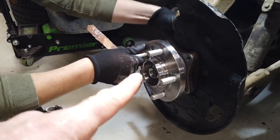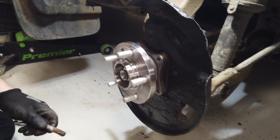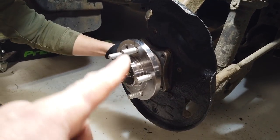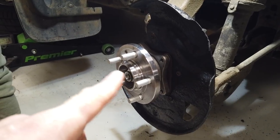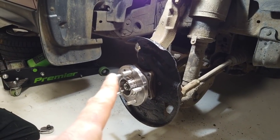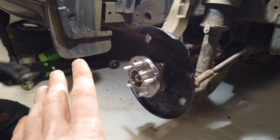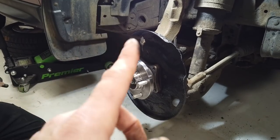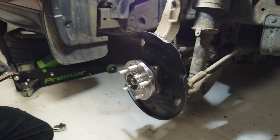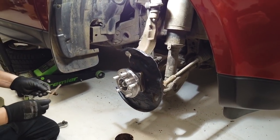We're going to torque that back up now. I watched another YouTube video on doing up a hub and I think he said 420 Newton metres to tighten that hub - so pretty tight. They used to say after you've driven the car a bit, just check it's tight again - you may have to retighten it. Basically, I think everyone can follow this - it's just putting it back together in reverse. I think that's a fairly easy job. We'll reassemble all the brakes and that covers one of our MOT failures. Then we've just got to look at the rear brakes, but by pushing the pistons back in and out I reckon that will fix the binding brake. Hopefully the next video will be me getting my MOT pass certificate.